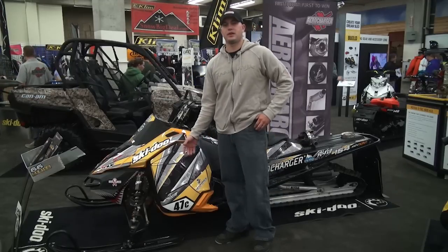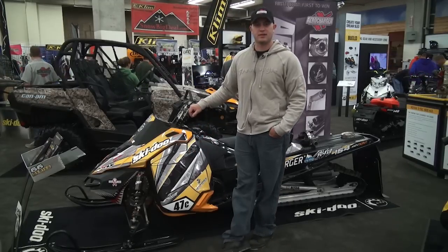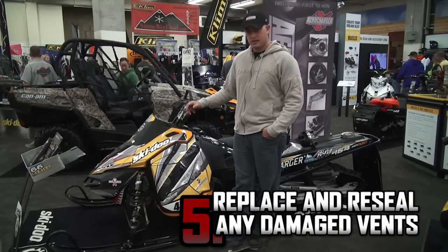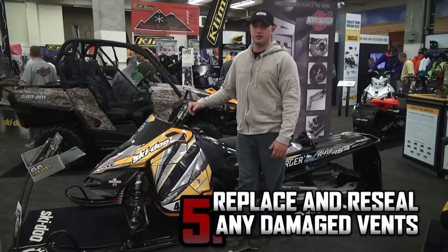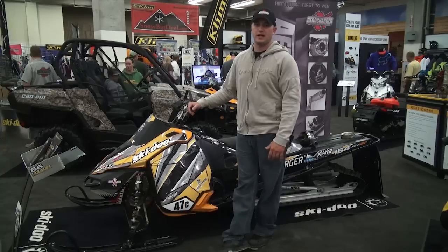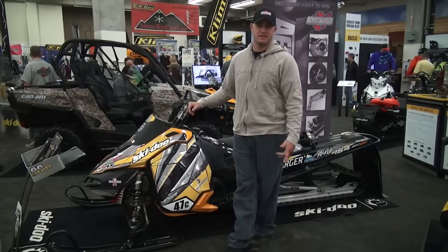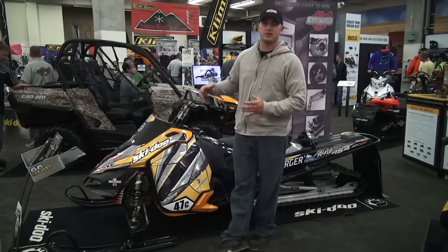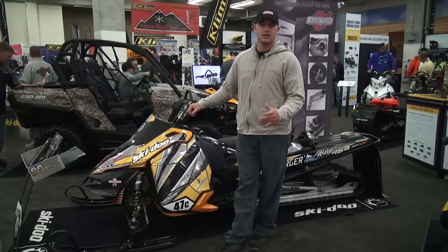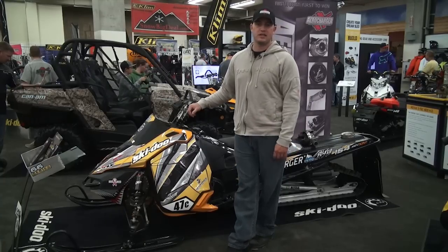This is a race sled we have here, so it doesn't have any venting on it really. But venting is crucial — you don't want water in there. Same thing: you're going to ride turbo, you're going to be flying through the trees, and you're going to put holes in some of the vents and tear some of that up. So that's one thing you want to check for the season — go over it, make sure all the vents are still intact, still looking good, and still going to keep the snow off your chassis.